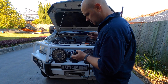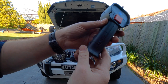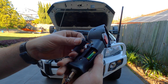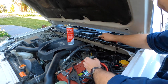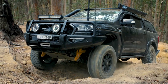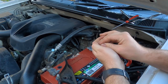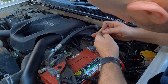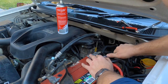This is the same as on a trailer plug and ensures a proper connection when plugged into the control box. And if you've got a Dominator Extreme winch with a wireless controller, just make sure that the battery hasn't gone missing or gone flat, and replace it as necessary. While you've got the bonnet open, check that the connections to your battery are done up tightly by giving them a wiggle. Winches draw heaps of power under load, so it's vital that these connections are done up tightly. If they've been loose for a while, corrosion may have built up under the terminals. Remove them one by one and sand clean using a bit of sandpaper, give it a quick hit of electrical contact cleaner, then refit and tighten properly.